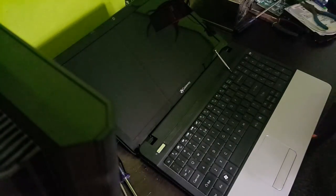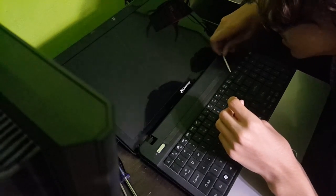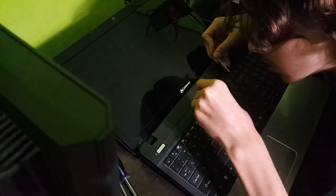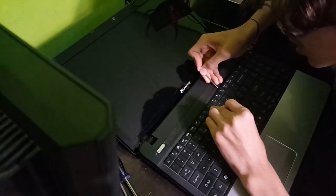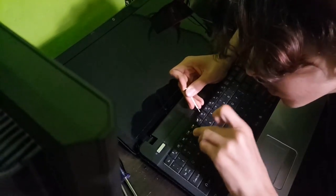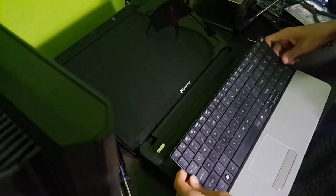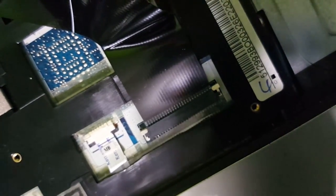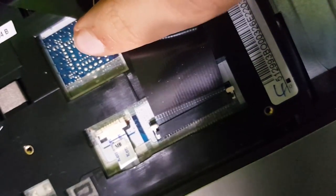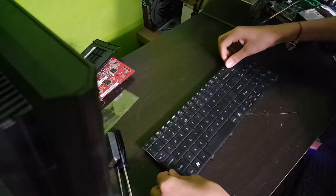If you're on a normal laptop, you may or may not have to remove the back plate — it really depends on what your laptop is. In my case, these were the things that I had to pry off: the clips that are holding in the keyboard. And there you go, the keyboard has come off now. Before you remove it, though, you have to unplug the ribbon cable. All you gotta do to unplug that is lift up these two tabs here and slide the cable right out.